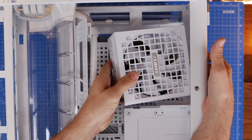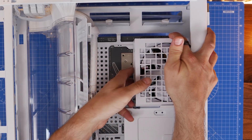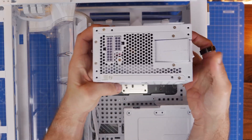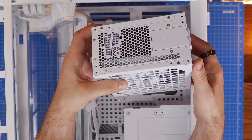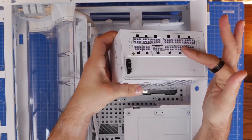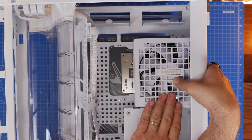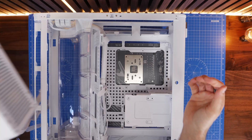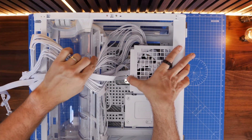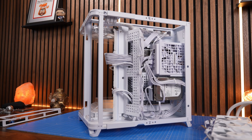It's worth planning the mounting of the power supply unit before you go installing it. I'm mounting it in a dual chamber case, putting it in so that the connectors will be on the left hand side, which will be a pretty standard setup. In order to do that you have to rotate the mains power plug to the back, but you can have it the other way around so that the main connectors are going towards the top of the case. This will be useful depending on where the power supply positions in your build and how the cables are installed — you have a choice whether it's sideways or straight up towards the top of the case.